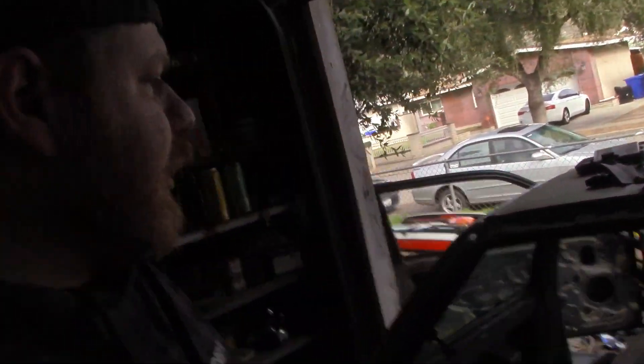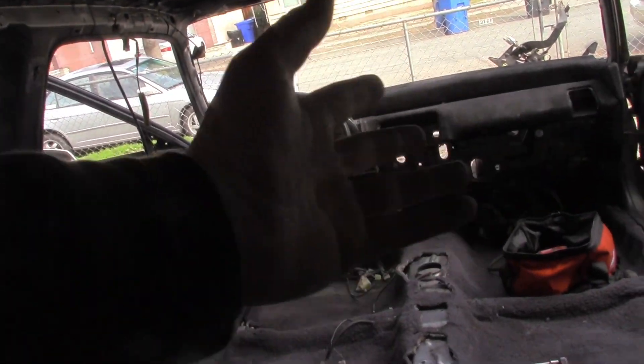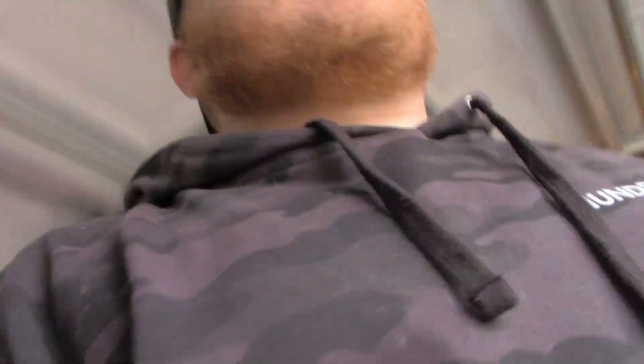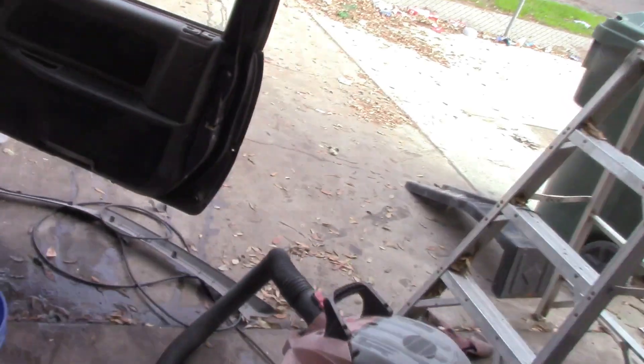We're back at Louise's house, working on the EF. I got rid of the bars here, there, and across. As you guys already saw, I have the dash, carpet, and one door panel in — I'm just mocking it up because it's still missing a lot of things, brackets here and there. I still have to go underneath and find the home for every single wire, because this is an EF with a CRX dash going in, so it's kind of difficult. I don't even think this door panel is the right year — this looks like a '90.